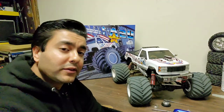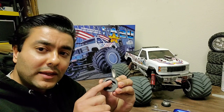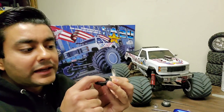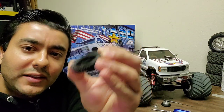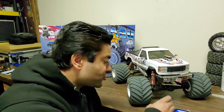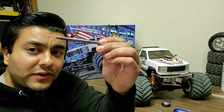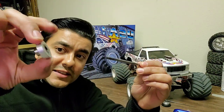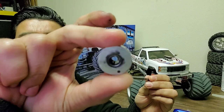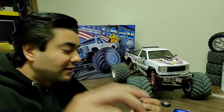I didn't crash anything, and also my second gear was almost close to being stripped as well. I'm not talking about the teeth on the outside — I'm talking about the cam on the inside was stripped, where the clutch bail is supposed to hook on to when it engages. I don't know if you can see that close enough there, I'll try and get some close-ups in. And then to top it off, this is the shaft for the transmission, this is the second gear cam, and it has a one-way needle bearing in it. That needle bearing is smashed and mangled to pieces — you can see a bunch of pieces in there.